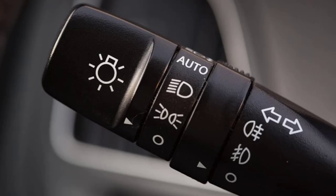You turn the knob to turn the headlights on. All those wires in that switch are really low amp wires, so they're not going to handle the amperage of running headlights up front. So you're going to have to have a relay in the system somewhere — when you turn the light switch on and turn it to power, you're going to have a relay to add power for the headlights.